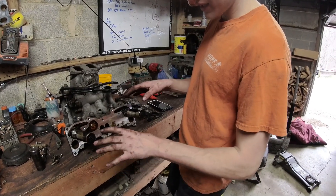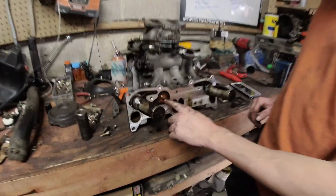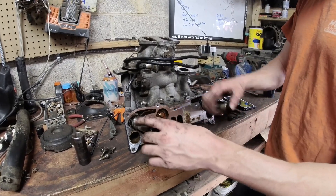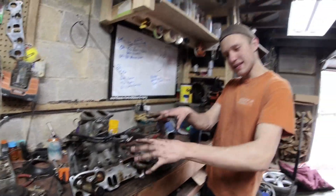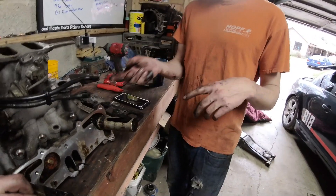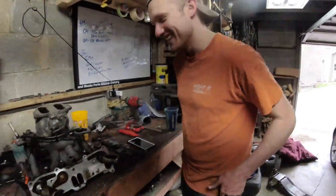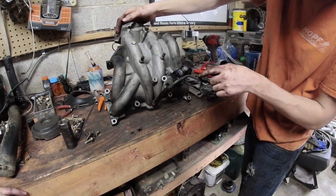This is a very, very problematic system. These plastic gears - yes, it's plastic, Mazda is dumb - and the rack part is metal. The plastic gears will strip if these get stuck, because the little electric motor just can't turn it. There are a lot of things that go wrong here, definitely contributing to the engine's low compression issues. Look at this carbon buildup - you ever see that inside a BMW N54? Walnut blast carbon buildup issues - same kind of thing.